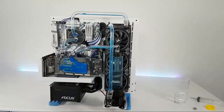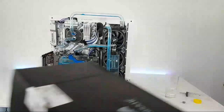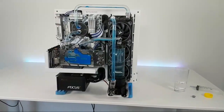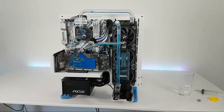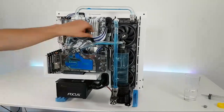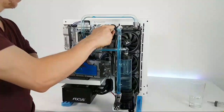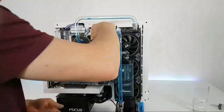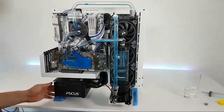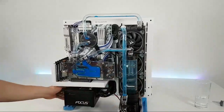What I want to do is bridge the 24-pin, which means I need a paperclip or something. I always worry about live streams — some big fail like leaving a port open or something. The top should be fine though. I need to run the pump to circulate the flushing water without the PC being fully powered up.